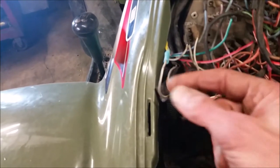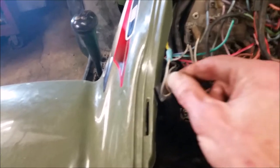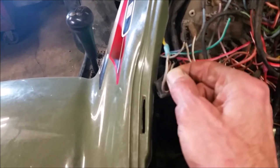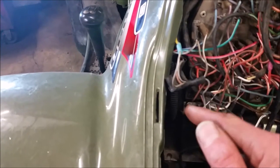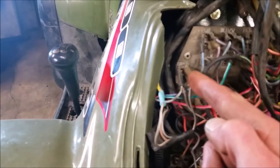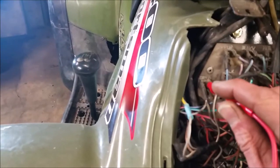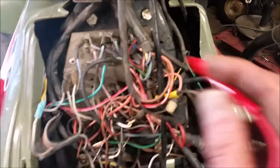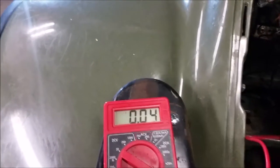What I've got here is a cable coming down with a gray wire with a white line on it, another gray wire, and then your ground. First things first, we want to check power coming in — going right up to here, this is going to your power. With the key on, I've got the ground connected and I'm reading 12 volts, so that tells me there's power going to the switch.